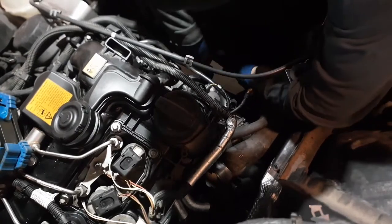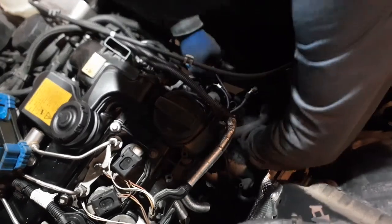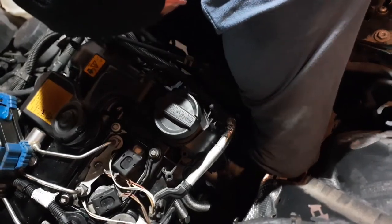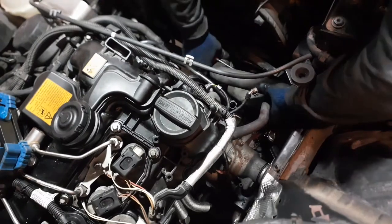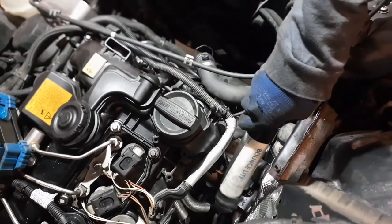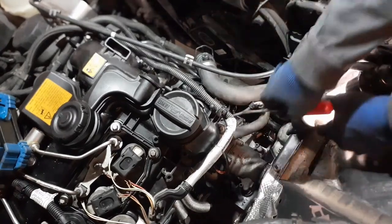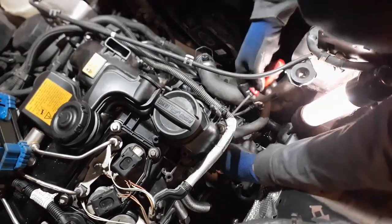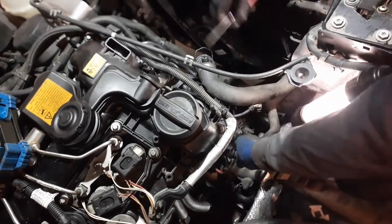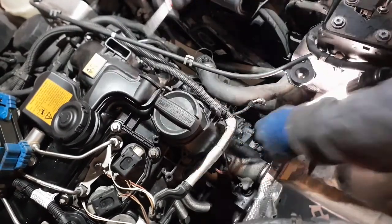Over here, somewhere. Okay, your charge pipe, bend it. It's rubber, and move it over here as well. You want all your pipes out of the way. Okay. Also, this pipe here, same idea, right here. Let's see where the connection is. Right here, you just want to lift the metal, wiggle it off, and there you go. Move this coolant pipe over here as well. So now everything is out of the way for your turbo to come in.